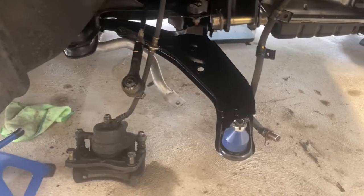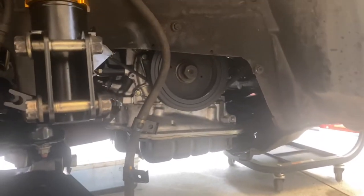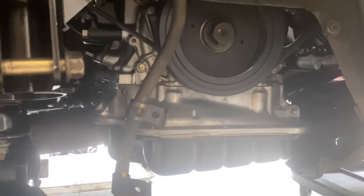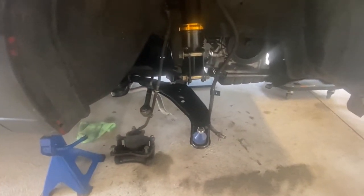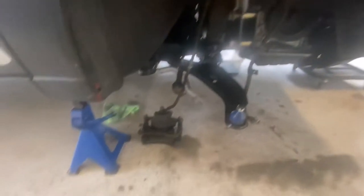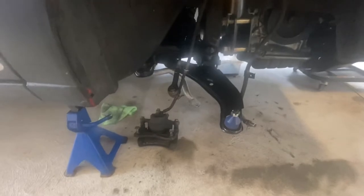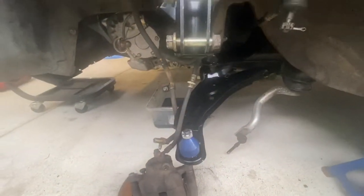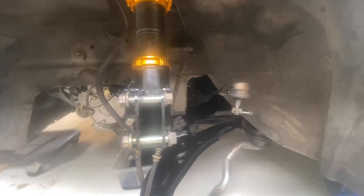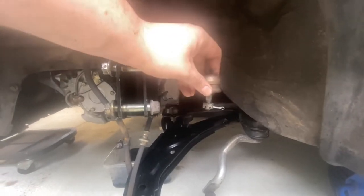Here on the driver's side we've got the lower control arms installed. We gave the engine a really good clean so now we'll be able to see where any leaks are coming from. The driver's side is ready to go. I'm going tomorrow to do the bearings in the hub so that I'll be able to put the hubs in, and then we can start on the brake swap — this is still the brakes off the N14, the N15 brakes are in the shed. I've ordered new power steering boots because they're both split, and I'm looking at the tie rod ends which I'll probably replace as well since I'm here.